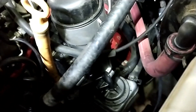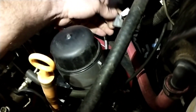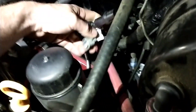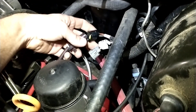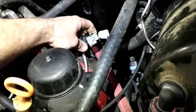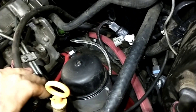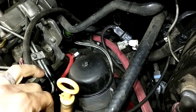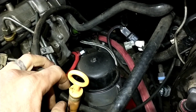The crank sensor is right here on the bell housing. I labeled the cam sensor there and this is the crank sensor. Since this Jeep Cherokee transmission is about the same era, I was kind of surprised - those suckers plug right in. I know I'm going to have to make a cam signal, but I can't believe the crank sensor plugs right in there - I'm not even going to have to splice any wire or anything. That is pretty awesome.